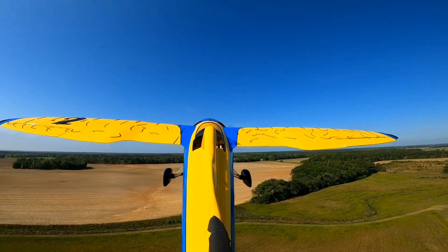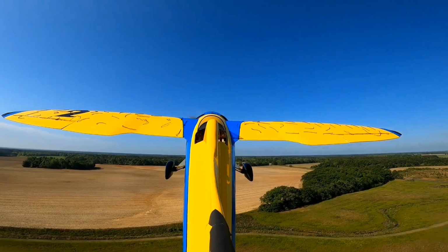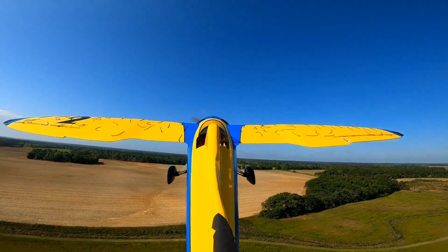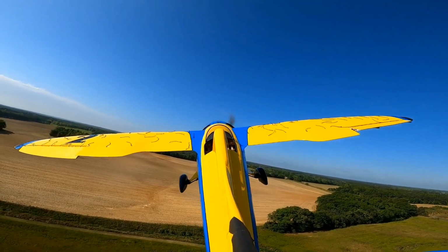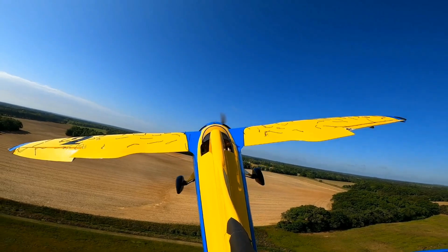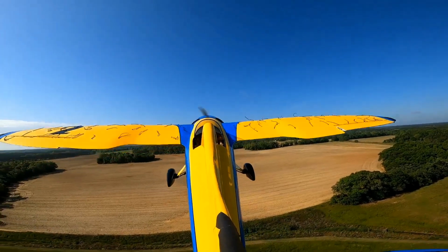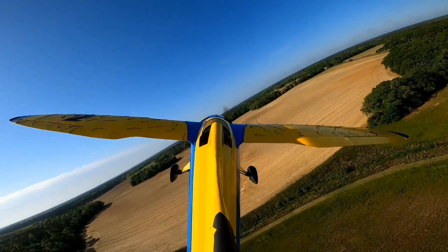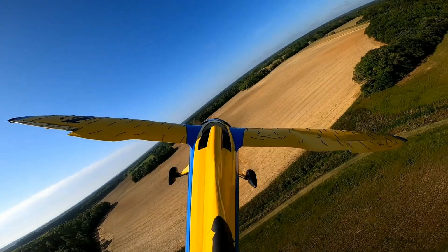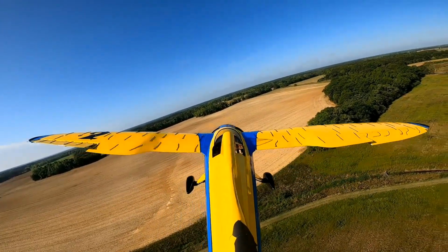Well, the left wing's not stalling now. There was just a little puff there. And then right here, the left wing's really starting to have all of it go haywire. So right here, the left wing is stalled because I got right aileron. Left wing's dropping. Now watch right then, you can see the wicks of yarn on the left-hand wing outboard are straight again, which means I've got control of that wing. The right wing stalled a little bit, but now I crank the aileron the other direction.